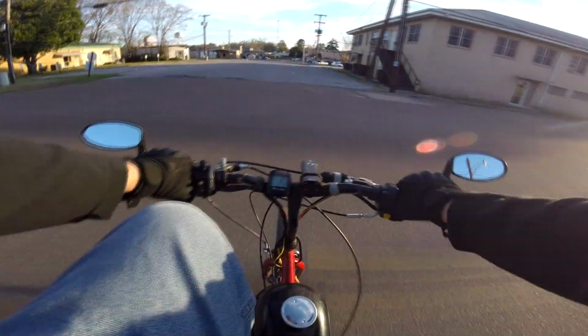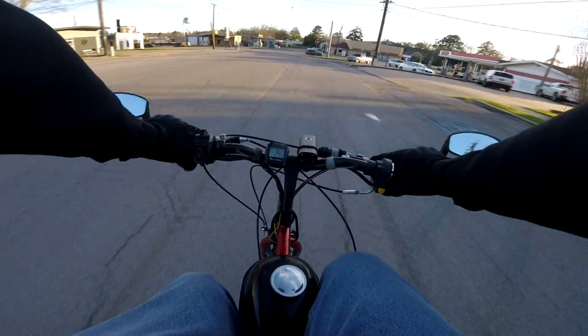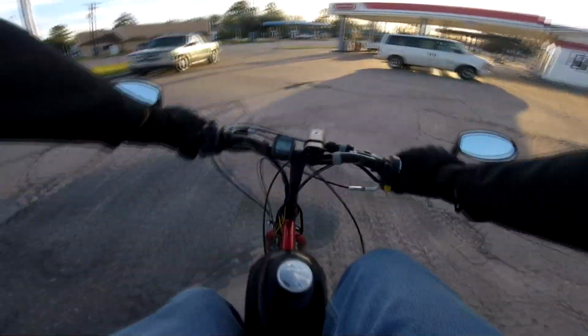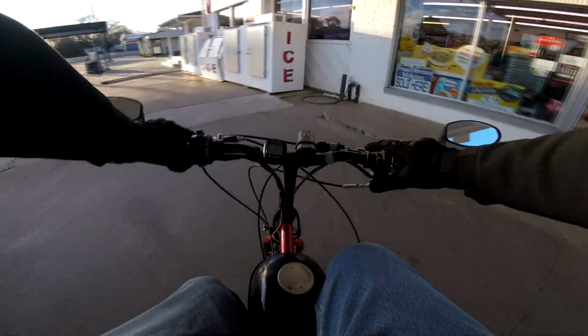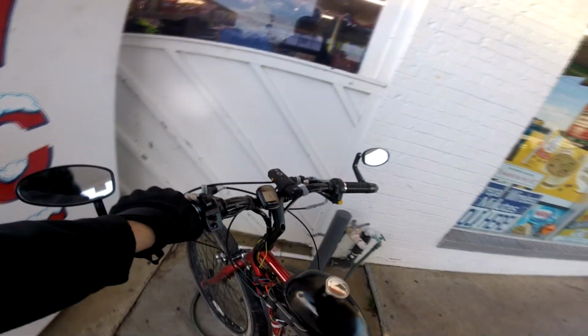The battery pack, as well as all of the electronics that I added to the bike, are an isolated circuit, meaning that they only get their power from the battery. They don't ground to the frame. They don't ground to the motor. However, the generator coil that we added to the motor doesn't have a negative wire. It grounds through the motor, which in turn can ground through the frame, which means that I can get my negative connection from the generator to the battery on any solid metal surface of the bike.